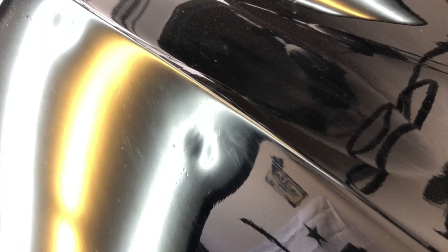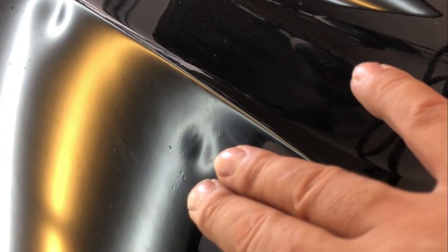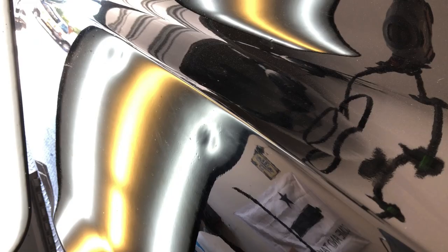Using the rubber end cannot fine-tune, but it still came out really good. Using the blending hammer from the inside is more dangerous because the paint is cracked — we're striking it from the inside, which is not a common technique for us. Since this wasn't a really common technique, I had to get the hang of it, and before I could start feeling more confident there were just a lot of slight taps. As I got more confident, I can speed up this clip so you can see how that metal is actually moving. It's not completely like traditional PDR, but it is the same concept — moving the metal outward from the back side.